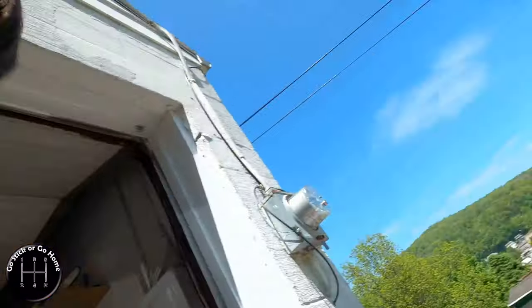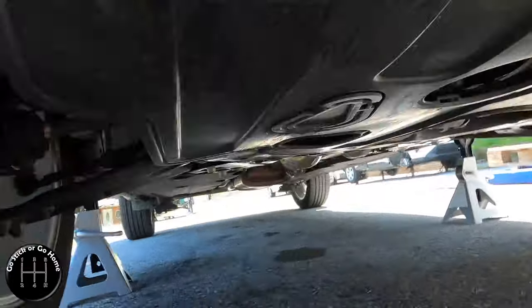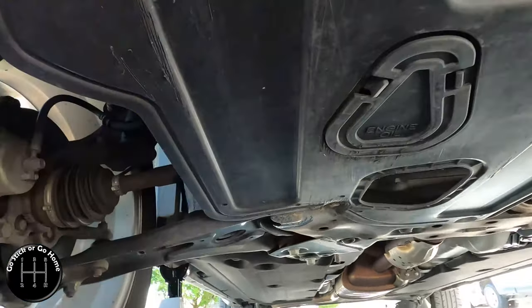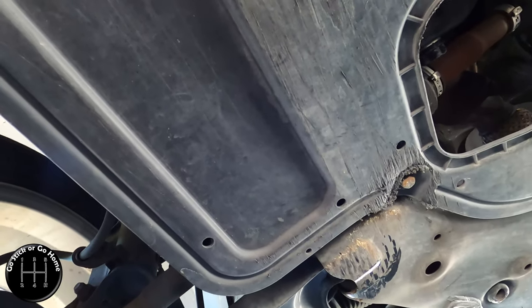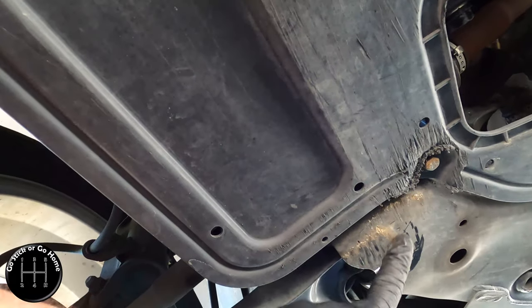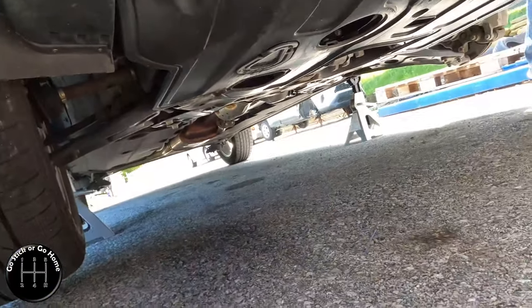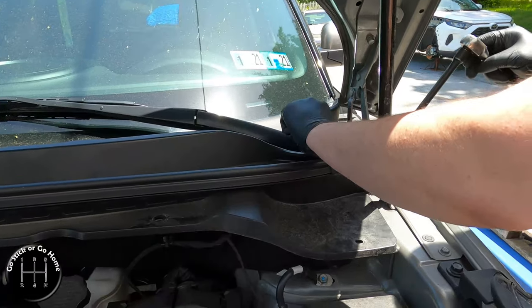This is going to be the process of putting them on and what it looks like afterwards. We have jacked up the front and put it on jack stands. When you get under here there aren't actual jack points on the chassis, so you just use the pad location right where the arm comes to - there's a little bump pad there. We're taking the wheels off; the stock lug nuts are 21 millimeter, so make sure to have a 21mm socket available.